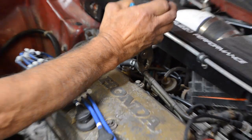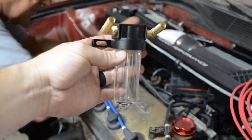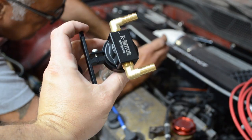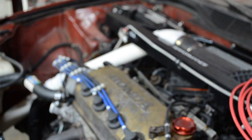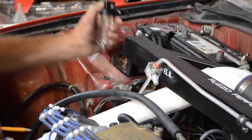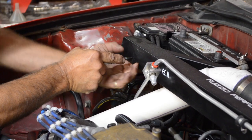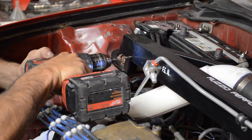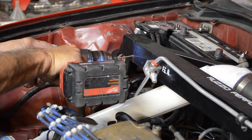So, as we learned in Connecticut, if you're going to race a Honda, you're going to probably burn oil. One of the more valuable tools a lot of these teams had was a catch can. That's not necessarily going to stop us from burning oil, but there will be less oil being recirculated into the intake, so we should run at least a little cleaner.